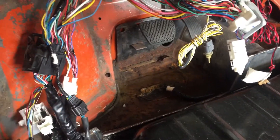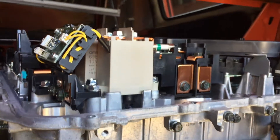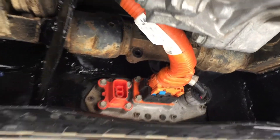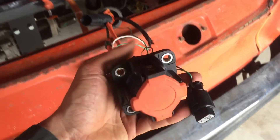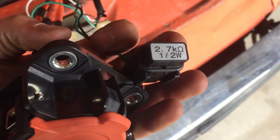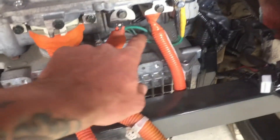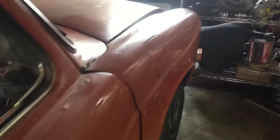Once I get everything up and running, then I'm going to clean everything up. Time to get everything connected in the junction box — the main motor cable. Now we're going to do the CHAdeMO. Here's the J1772, all kind of disassembled. It's a big resistor — 2.7 kilohm, half watt — which I believe is for the pilot connection. And those terminate right here. I want to put this plug right over here.